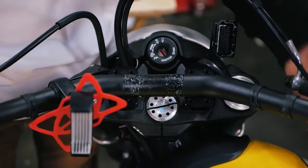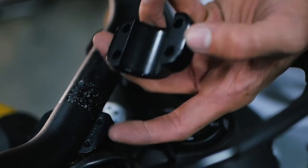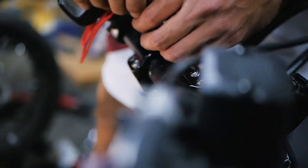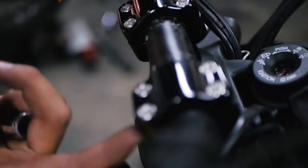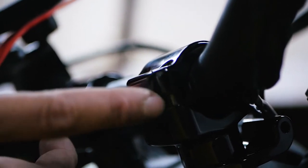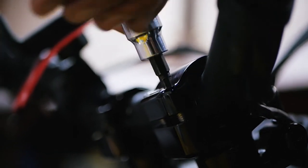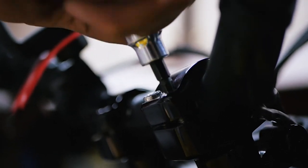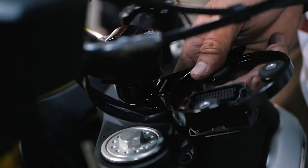We can put our handlebars on and make sure they line up right. Have our little three marks here line up with these three marks — same way in the front. When you're tightening these on, you kind of want to do them evenly. If you look at this side, the gap here is much larger than the other side — I like to keep them even. So you can back off one side a little more and clamp down on this side a little more, and that just evens up this gap.